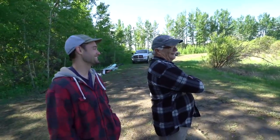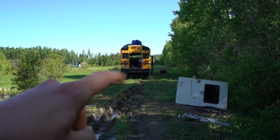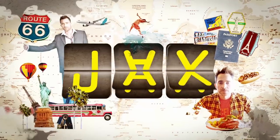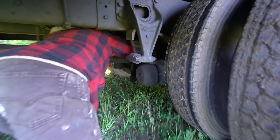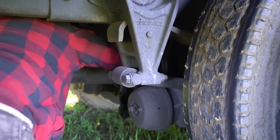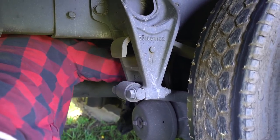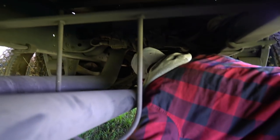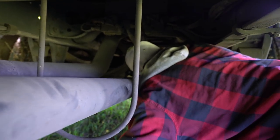That's right, we are gonna change the rear end of the school bus, and it might be today. So we went over this before, but the proper way — besides telling a dealer your VIN number — is to get back there and get the tag and see what the rear end ratio is. This is ratio 4.11.